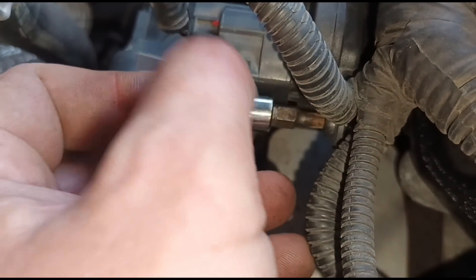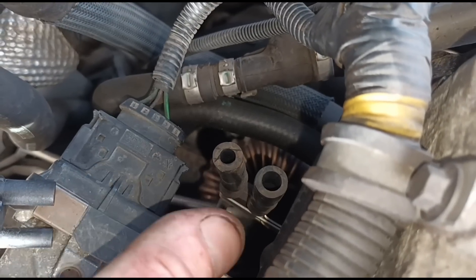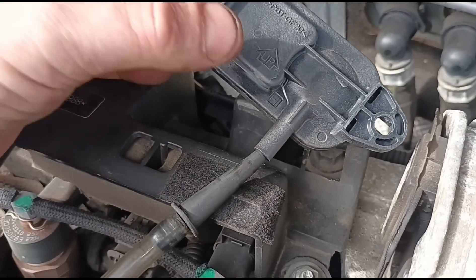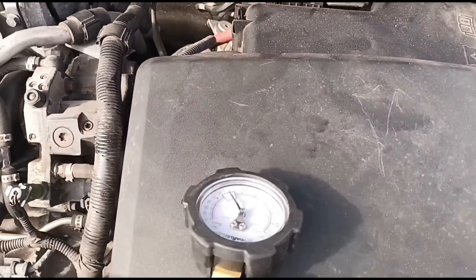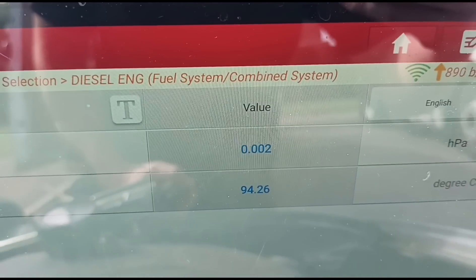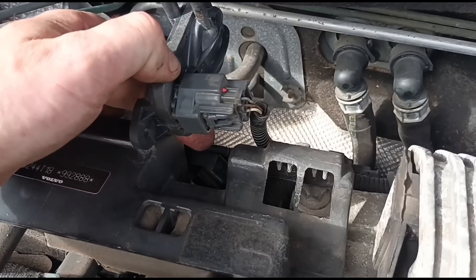Once you've got it loose we can just unscrew it by hand. Now we just pull the sensor out of the tube — you'll have the two tubes right there. What I'll do here is connect up a pressure gauge to the sensor. This side here where it says 'hi', connect that up and push that in. We'll watch the live data on the screen and increase the pressure, and we should see the same reading on the sensor there. But the sensor doesn't move. So we know the sensor is not giving any reading — it's going to be either a dead sensor or bad wiring.